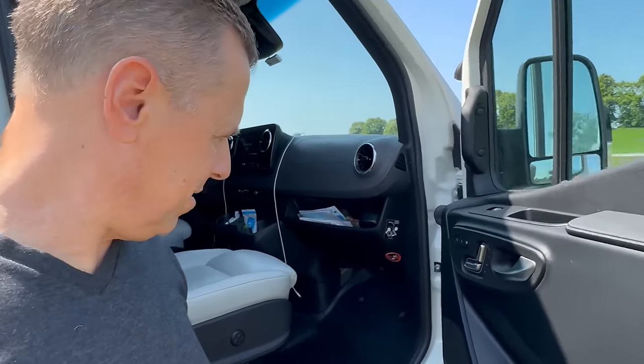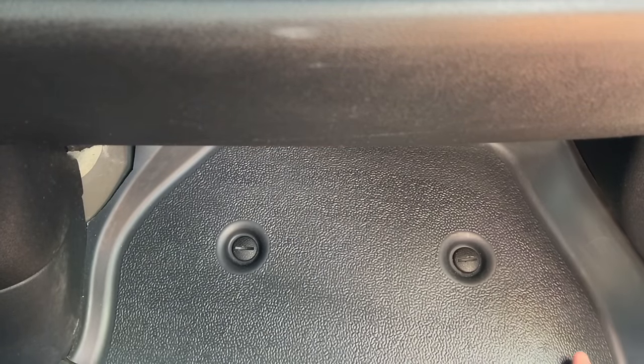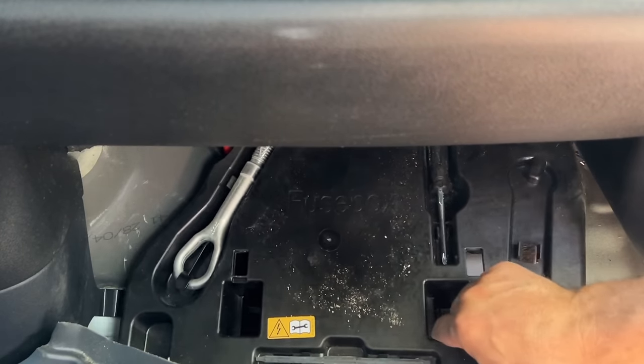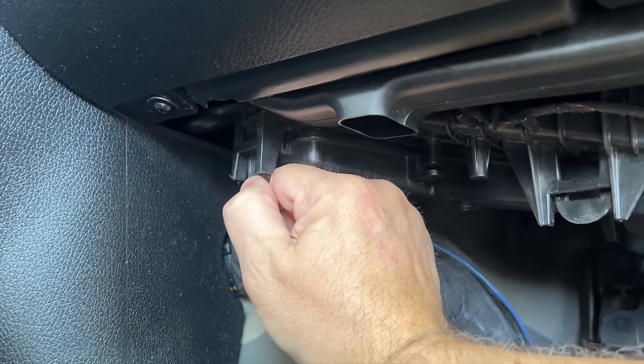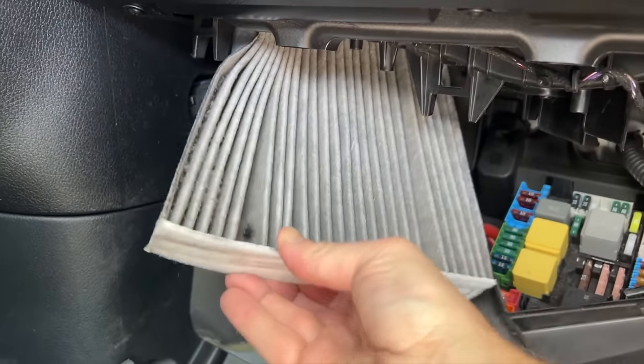After you remove your floor mat, loosen those two screws and take that cover off the floor. Underneath there you'll see a tool set — you've got to take that out, because in order to get the air filter out from above, the tool set has to be removed or the filter won't come down far enough. Then look up underneath the dash — you'll see a little cover with a few tabs you have to squeeze to pop open. Once you pop that cover off, you'll see your air filter. Just pull it down and out, then run to an auto parts store.